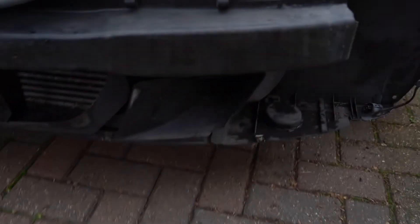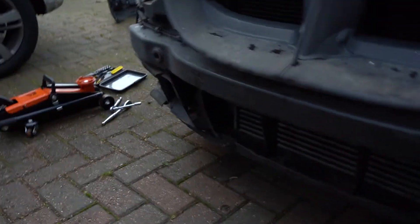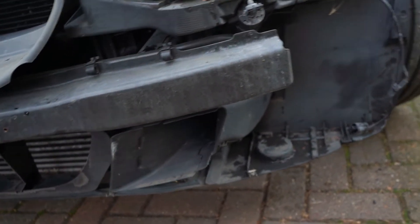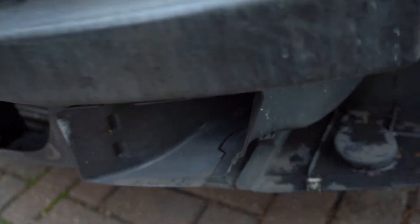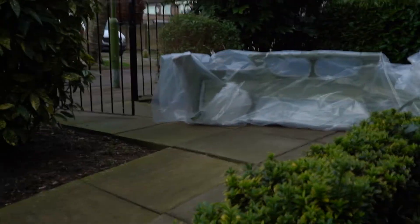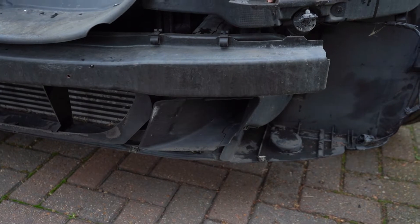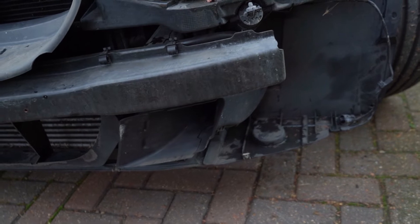The problem we have is you've got one and two over there — these are actually the brake ducts. They go through here into there. For the time being I'm going to remove them because they're in the way of the bumper, but you can cut them back to about here and they'll still be useful because they'll line up with vents on that bumper. For now, just to get it test-fitted and see how the fitment looks, we're just going to unclip them and remove them. The car isn't being driven hard at the minute anyway.